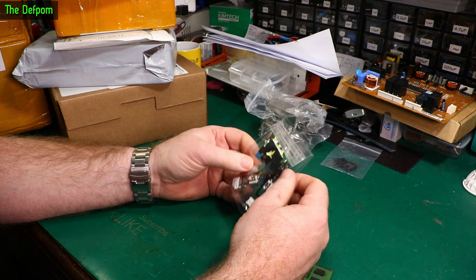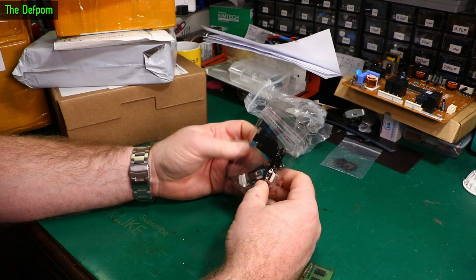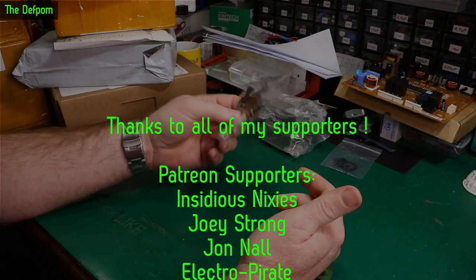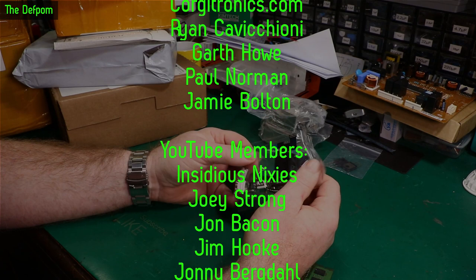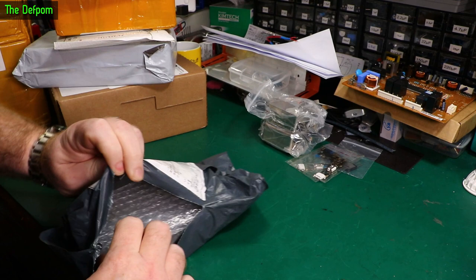There's an iPhone I was fixing - the dock connector was bad. I bought one from China and also one locally because I got impatient; I should have just waited. That phone needs repair. I've already replaced the dock connector and it's got some spares now. These are for the iPhone 6s Plus. Someone gave me one and said 'have this phone', but it turns out the logic board is bad. I did all repairs to it and the thing's still dead because the actual logic board has failed.